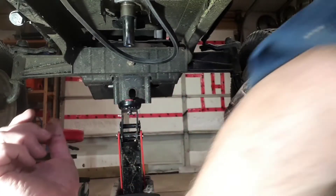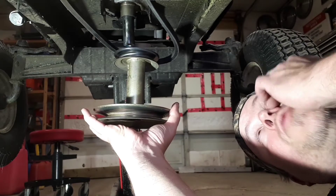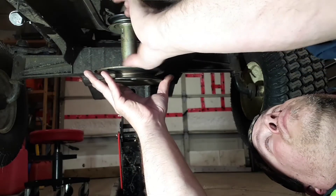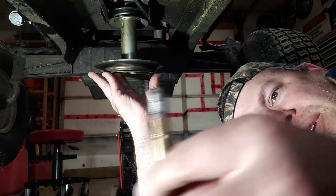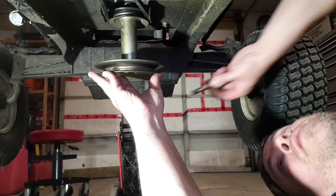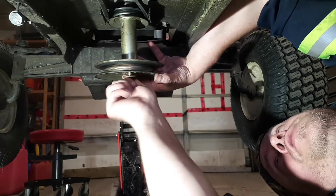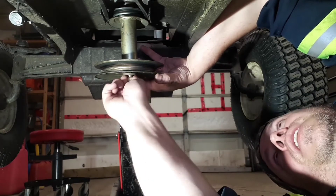Got the spacer back up in place. There is a key on this pulley, so now that there's no tension on the belt and we're in the neutral position, we're just going to slip that on and line up our keyway. The belt's got to go inside these little retaining guards here. I put some red Loctite on the bolt because there were vestiges of red Loctite on there and we don't want this rattling off. For torque spec, couldn't find anything specific, but the chart for 7/16-20 grade 5 — I thought it was a grade 8, which said 60 — so it's probably something more like 40, which seems pretty adequate.